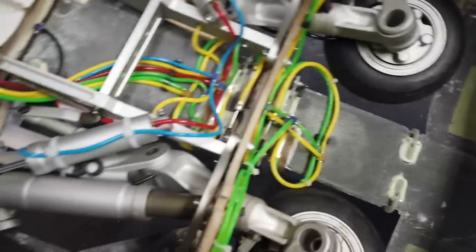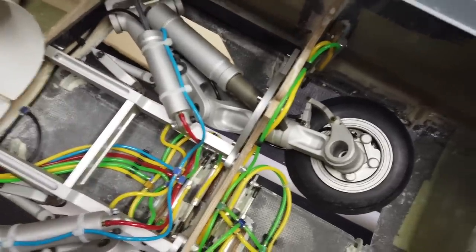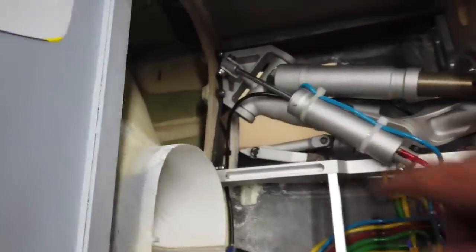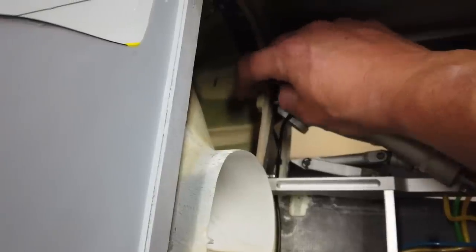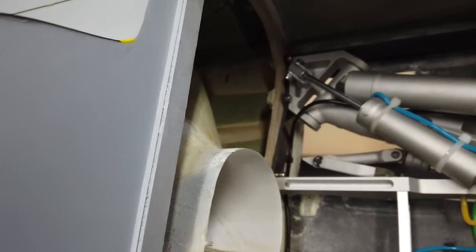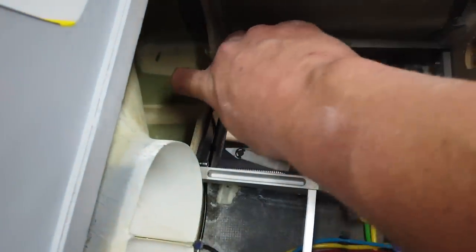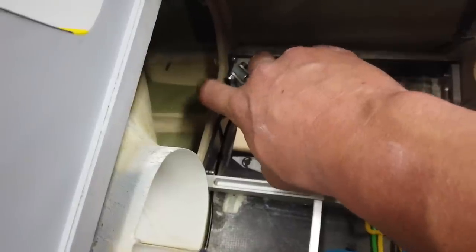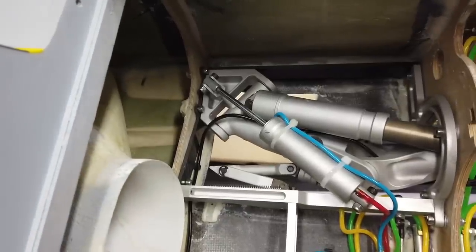Here's the inside view with the gear doors open. We're going to drop this gear and then focus on any of the bolts that go into blind nuts - all these guys on the back here, they all go into this former into blind nuts. So we want to make sure we lock-tight those. There are six on each side, so twelve total. These front ones have nylon lock washers on the other side instead of blind nuts. I'll take my mirror and check that out. These airlines here - we want to wrap those in a protective snakeskin material, just because when this gear retracts it's going to be spinning, and if it spins against those airlines it can puncture them pretty quick. This one actually touches the tire, and when I spin this wheel I can see the gear is rubbing the brake line.